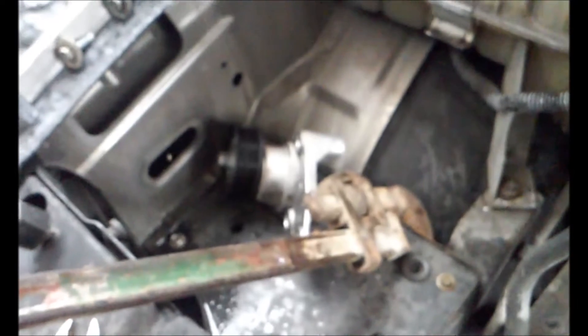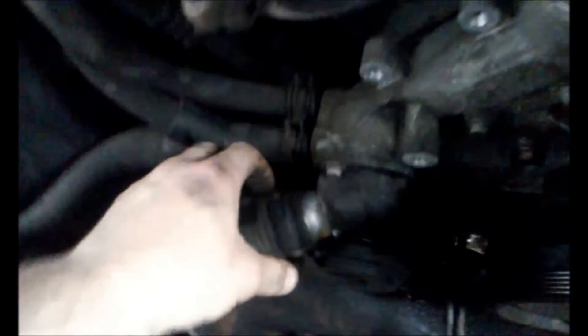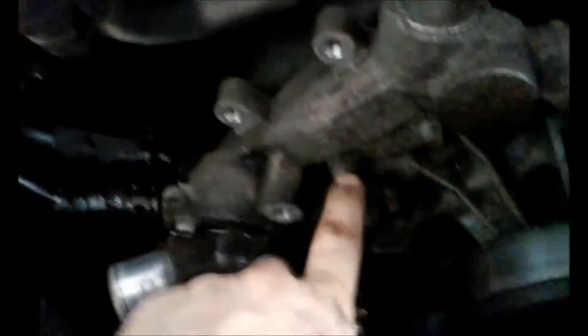I pulled the belt tensioner pulley off — so that's out of the way. I've gone ahead and taken back this clamp and worked this loose, so now we should be able to pull this hose off. I can leave this all together since the new one comes with everything, but we do take the hose off. There we go — a little bit of antifreeze on the ground there. So now we can get access to these 10 millimeter bolts here. We'll take all those out and we should be able to pull the water pump off, after we disconnect these two hoses here, which I'm going to do next.